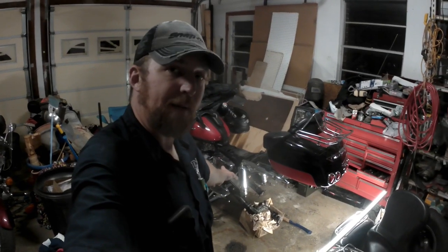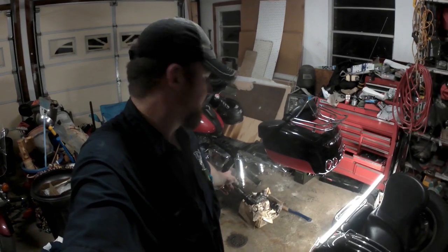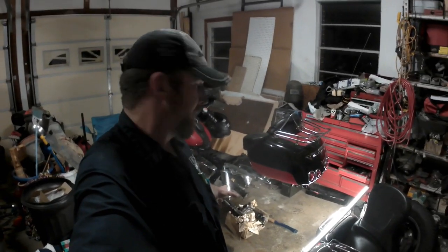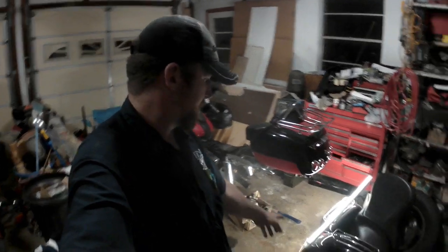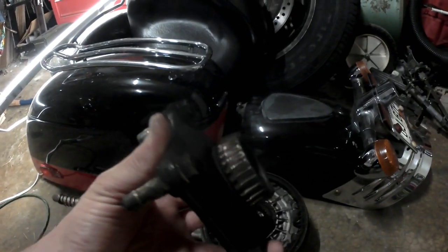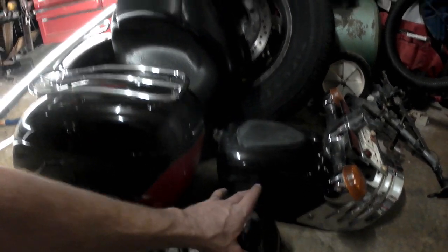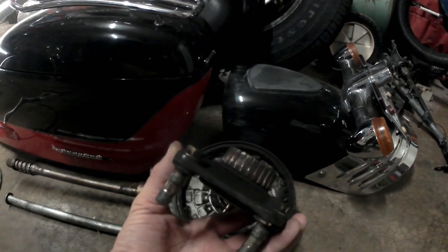As we get this bike put back together and back on the road — the original video that I posted was about three months ago now. I've been getting all the parts together and getting a game plan going so that I could start on the bike, but that was when I destroyed the original final drive. Coming home from work one day, she started grinding and it tore the spline out of the final drive. I did a whole video when I tore it down — I was thinking it was this pinion cup here, but it turns out it tore out the splines on the drive flange here.